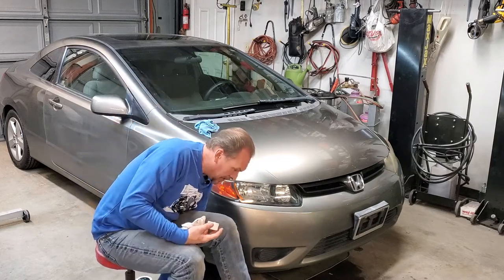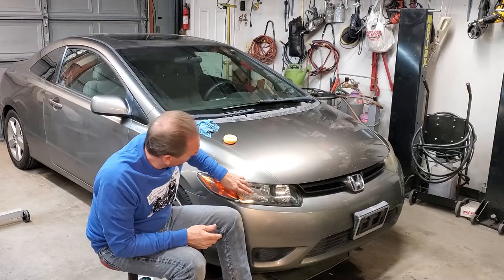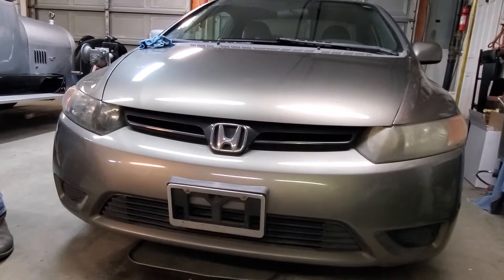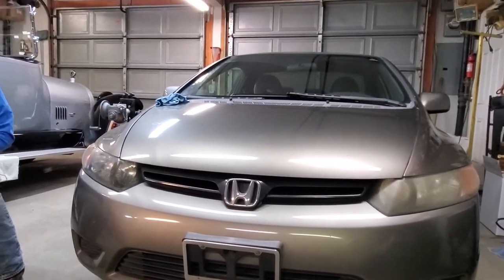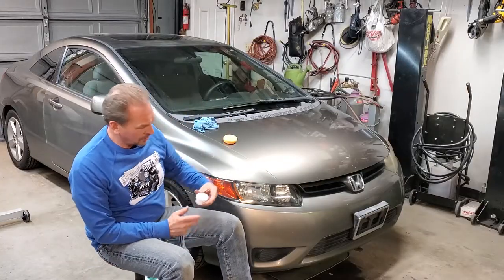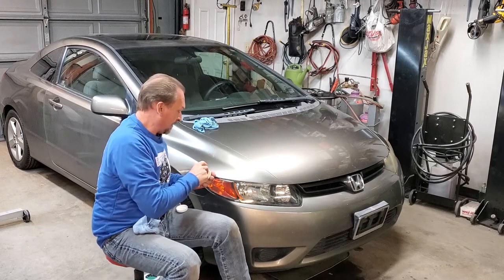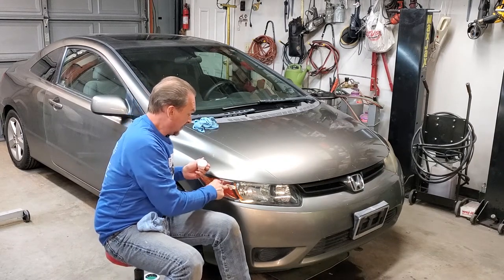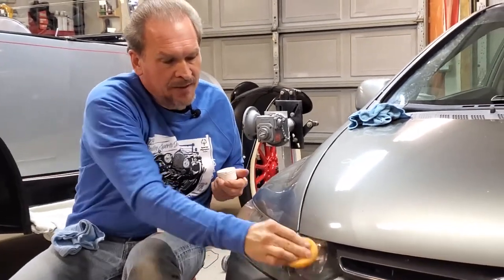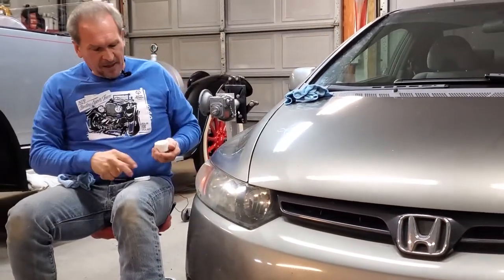Now, if it were like the Solstice — which you'll see in the video — the headlight will look pretty close to new. Things this won't take out: no chance it's going to take out little chips or cracks where the headlight has been hit. Those aren't going to come out — the product clears the plastic. Now I've got the plastic cleared up. Your next step is to take the clear coat and apply it with the orange applicator, rubbing it all over the surface. You want this to sit for two minutes before you take it off.